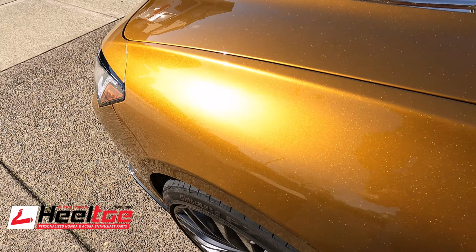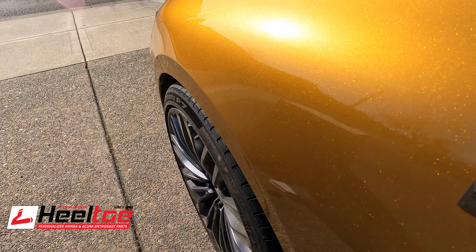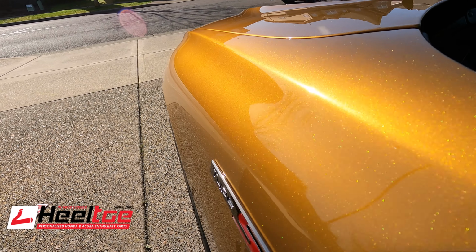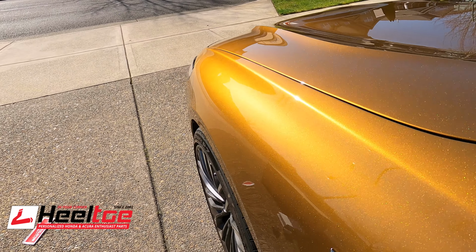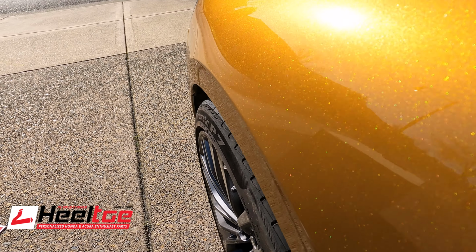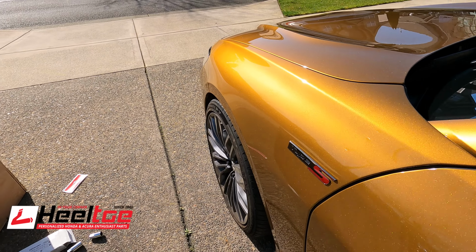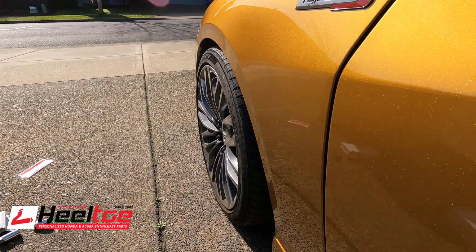This is the reason why 25mm spacers are really the favored spacer size for this car. 27mm spacers are available as well from H&R, but if you can imagine just what 2 extra millimeters would do here, it's not a lot of spacing, but it does get to be a little bit much at a certain point.